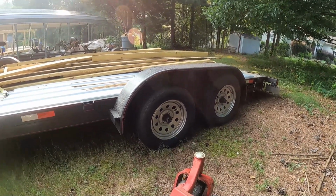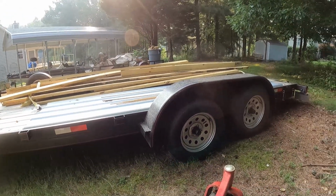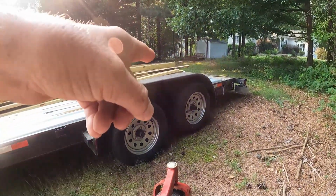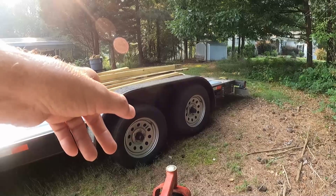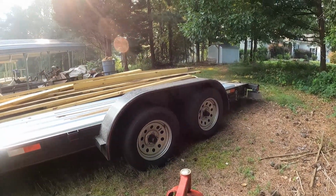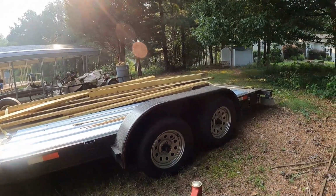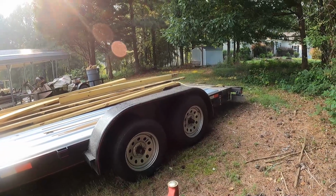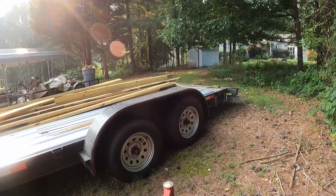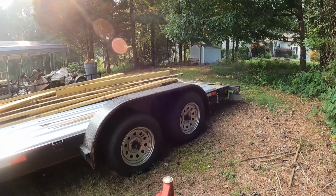It's a 5-lug, so those are 3,500 to 7,000-pound capacity. But the damn trailer probably weighs 3,000. You got the heavy-duty ramp holder, nice layout. It just needs bigger axles on it. You need 5,000-pound axles. This needs to be a 10,000-pound. For the amount of deck space on that trailer, if you put a vehicle up on there, you probably could, but you're going to be hitting the capacity pretty quick.